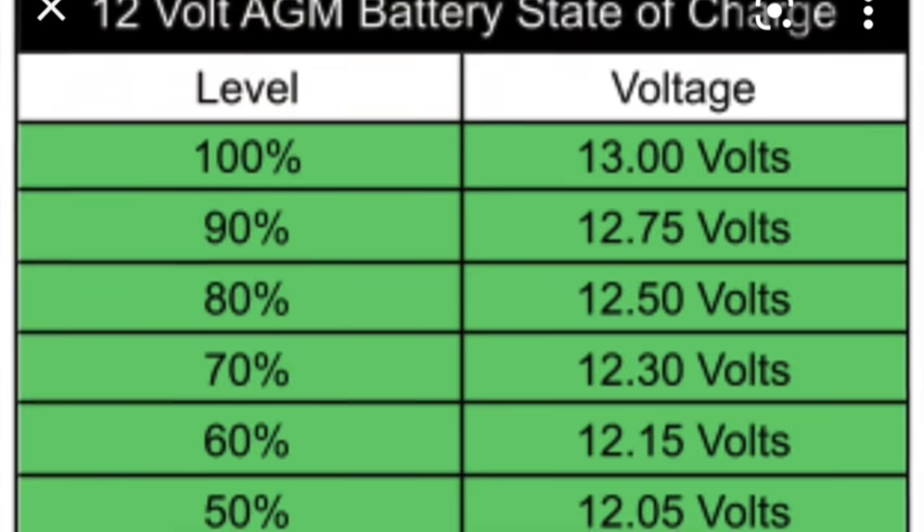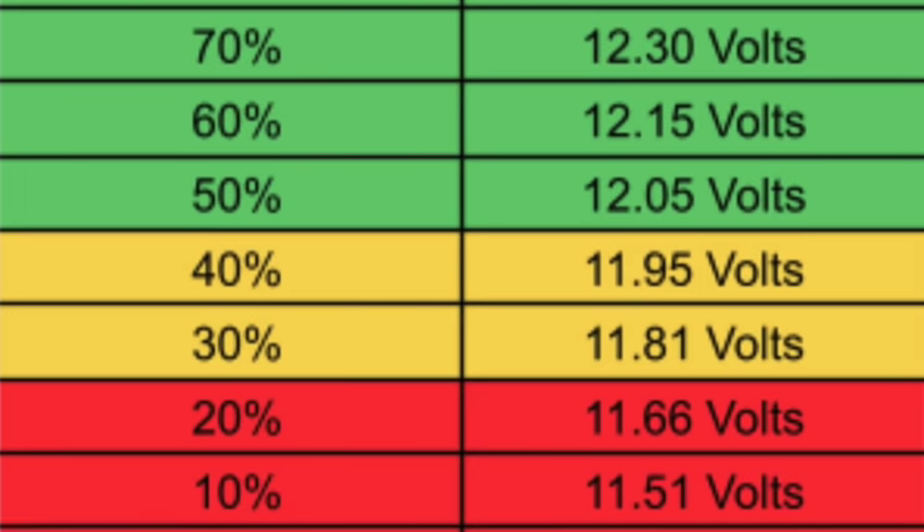But it's not just about the weight saving. People need to understand the capacity and what you can actually use from old-fashioned lead acid or AGM batteries. They have lead panels with a chemical and acid between them that allows electrons to move. AGM and lead acid are the same type of technology. With lithium it's completely different — you can only use a percentage of lead acid or AGM batteries before you start to destroy them. If you take a lead battery down below 11.8 or 11.9 volts, you're going to do permanent damage — each time it will degrade a little and never work quite as well.